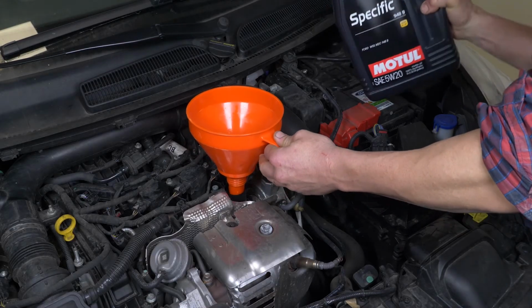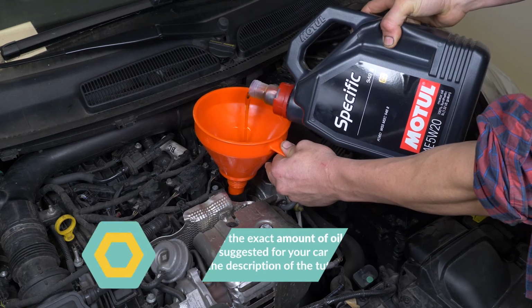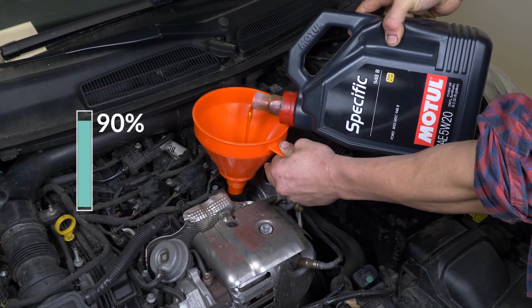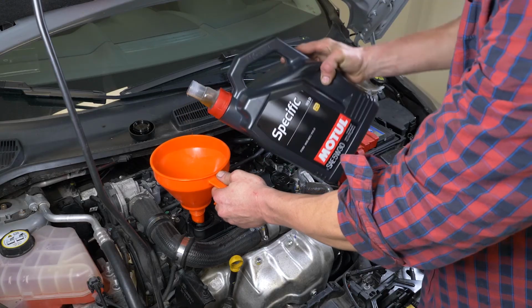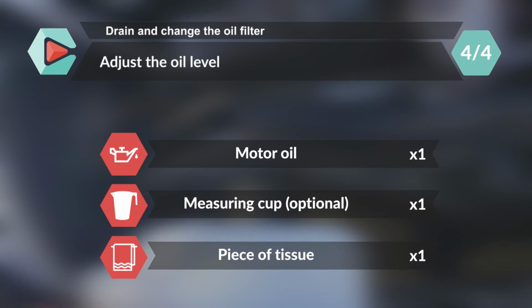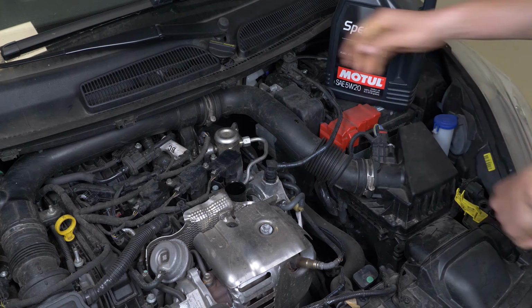Now, add the oil into the engine. Begin by putting 90% of the suggested amount. This will leave you a large enough margin to adjust the level of oil appropriately. You can find the exact amount of oil suggested for your car in the description of the tutorial. Close the oil fill plug.